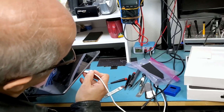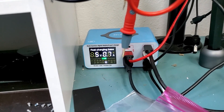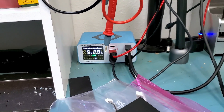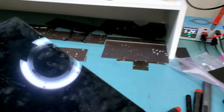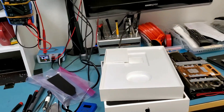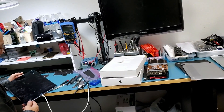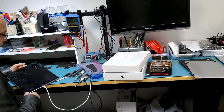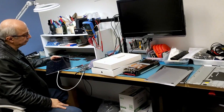Plugging the charging cable in — we do not want to see 0.6 amps. Oh, look at this! It went up to 2.9 amps — amazing! We see the battery logo right here. The battery is fully drained, but the important thing is 5 volts, 2.9 amps — that's amazing. It's going to take about 10–15 minutes for the tablet to come on because the battery is totally dead, but the tablet is fixed. Replacing the chip fixed the tablet. Awesome.